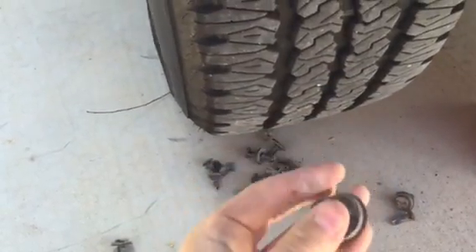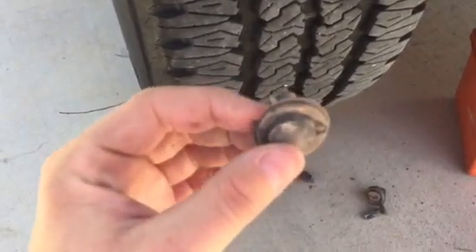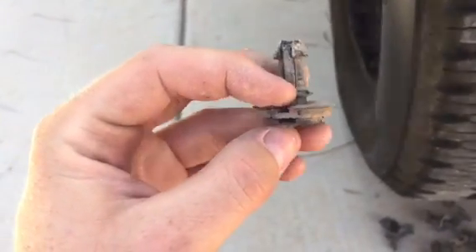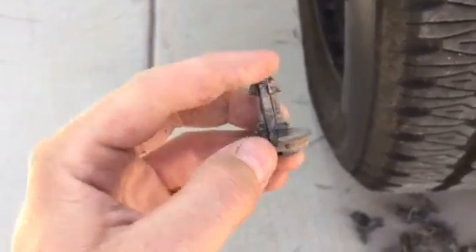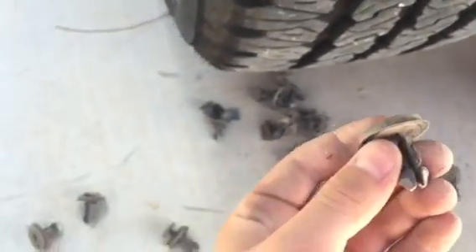The pins are pushed all the way down inside on the truck, and that's what's holding the bumper up. What you need to do is stick a screwdriver in that little notch — that's the visible part — twist it around and pull the middle piece out. What you'll be left with is one of these little things that pulls out, and when you pull the bumper off you're able to find the other part.